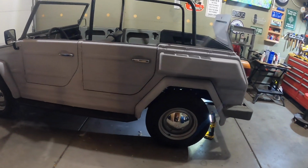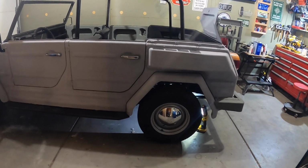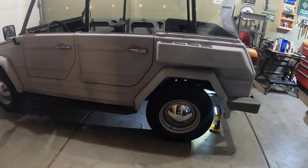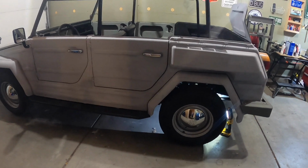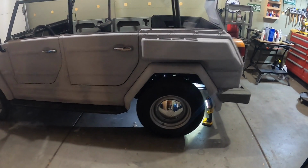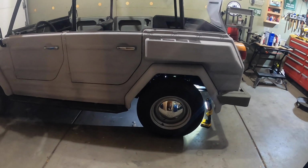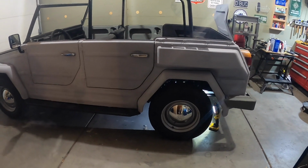They're totally adjustable up and down. If you've got a little bit of extra load too, the extra coil helps the torsion bars handle the weight a little bit better. I got them in, and I'm on the second click. There's like 6 clicks. You can jack it up about 2 inches, but I just raised it maybe an inch or so. So the second click on the shock.